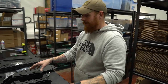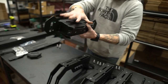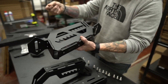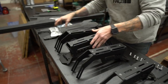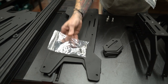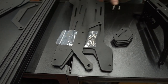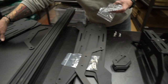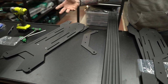When you guys get this and you get it unboxed, you're going to find that these are all shrink-wrapped, tucked inside of each other, with bubble wrap around them and then shrink-wrapped again. When you open them, pull the shrink wrap off — just be aware that you've got a powder-coated finish underneath, so don't dig at it with a knife. Just pick at the shrink wrap until you get it started and then it'll unwind. You'll find bags of hardware. There's one with four bolts for your Max Trax hardware, and there's a label on them. The instructions include a CAD drawing showing which size hardware goes in which hole, and which slots and holes on here can be used for what.